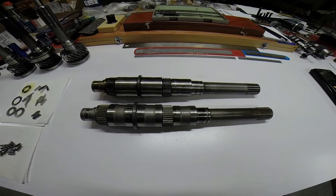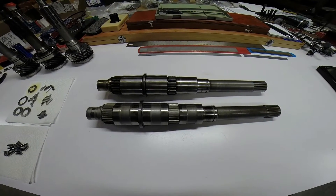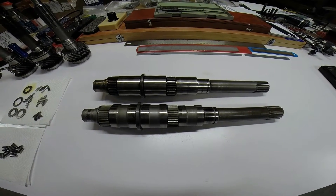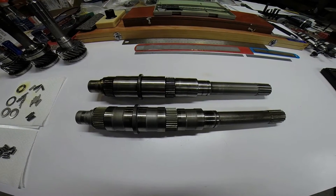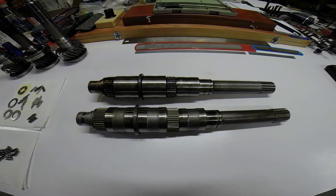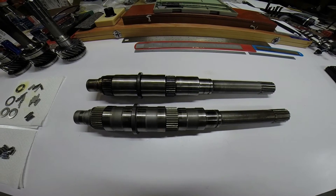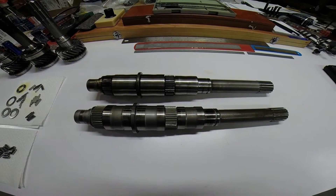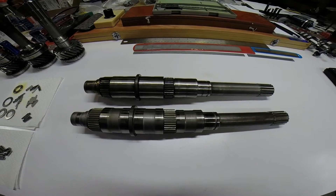Good afternoon everybody. Today we're going to explore the idea of providing an upgrade to the original Ted Trevor Corvair 8 transmission design. Back in the late 60s, Ted Trevor had designed a method to have a Corvair transmission with the input shaft of a standard Saginaw transmission, to be able to bolt a V8 engine to the Corvair transmission. He did it in a manner that was fairly successful, but it did have its shortfalls.